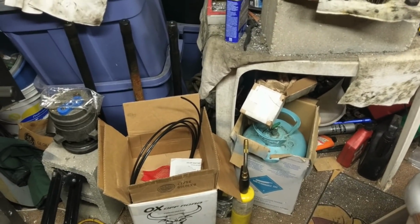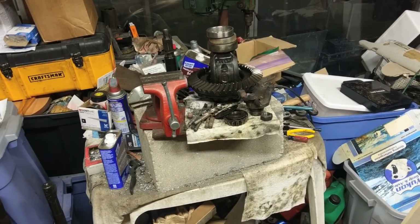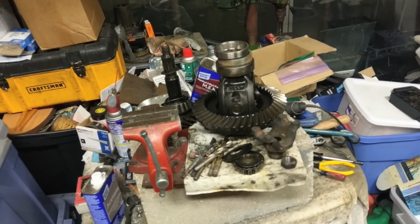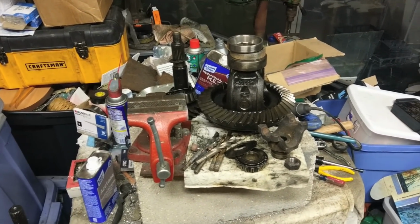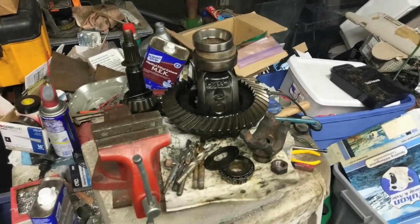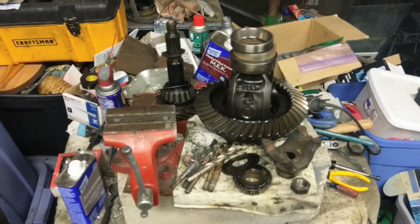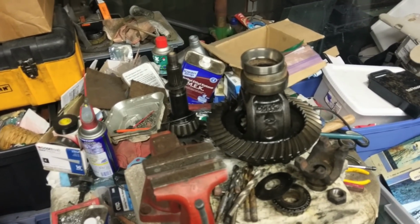And to go along with those bigger axle shafts and that beautiful locker, it's going to be a new gear set. 456. May or may not be out of a JK Dana 44. Has the name Jance 4x4 ringing any bells? So, the smart guy, Carl, that he is, has developed a kit that allows you to take the newer style JK Rubicon Dana 44 gear set, the ring and pinion, and fit it inside of these smaller, old-style housings for the Dana 44. So, you basically get gears that are quoted to be 44% stronger inside your regular housing. Tell me that doesn't sound friggin' awesome.